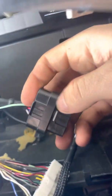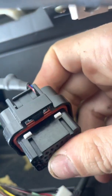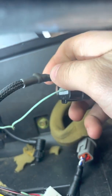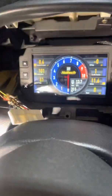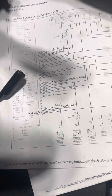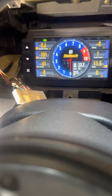As I'm pinning this in, I figured out you have to push in that connector right there for the pin to actually make its way in, and then once you're done pinning everything in you just push these back down and it'll lock back into place. I've got it pinned in — just have to check to see if it does work. And it does. I'm just going to follow the wire colors and show you which one and which connector it is. Basically you're going to repeat this process for all the rest of them.